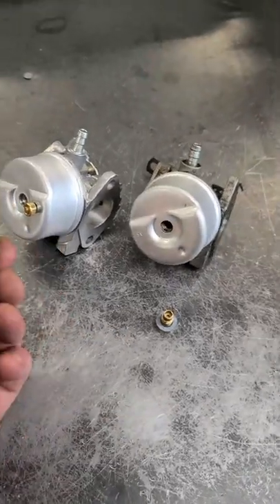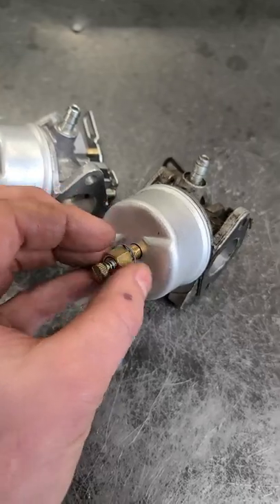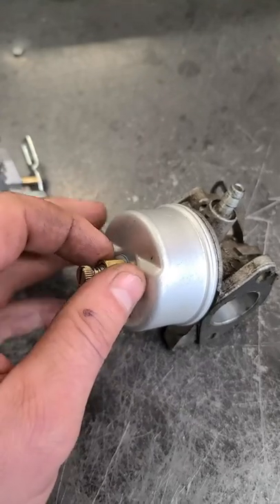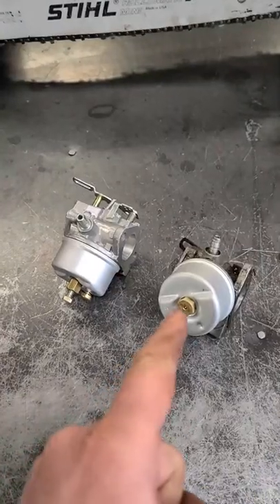The main reason why you can't just put the adjustable screw on the non-adjustable one is because it does not want to screw in all the way. You'll be able to screw it in a little bit, but at a certain point it will hit some parts down inside the carb.